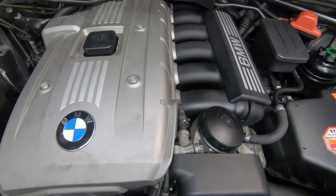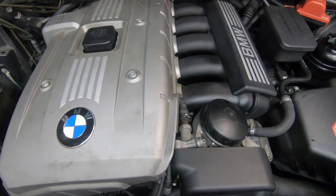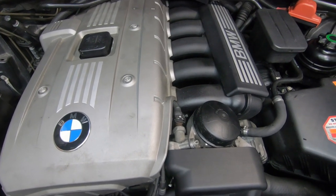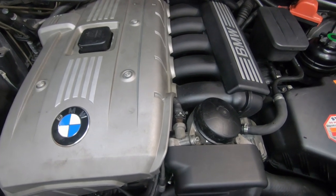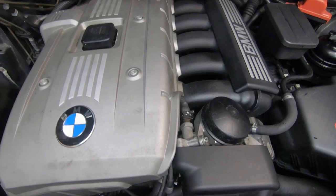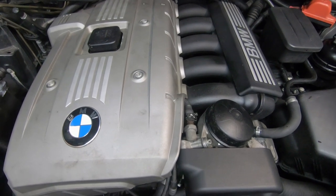The vapors are burned in the engine, which is why many of you get carbon buildup — it's a common problem. The purge valve is monitored by a number of sensors on the engine and will throw a check engine light if it fails. The most common problem I hear about is the valve sticking or not fully closing, which causes a check engine light.